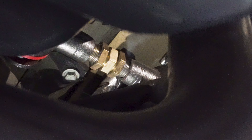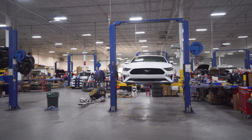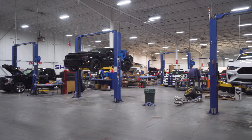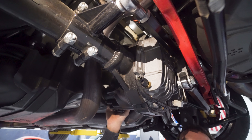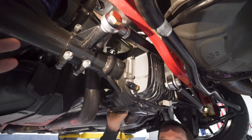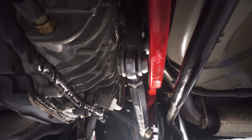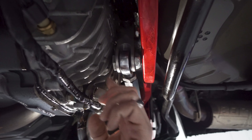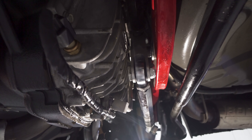If those don't hold it, this thing — you spin it one way it contracts, makes it shorter; you spin it the other way it extends, makes it longer. And obviously it's gotten to the point where now you're bumping on the cradle for the watts link. If it didn't start rubbing on there it would have kept going — I'm not sure how many more threads are in the ends, but if it goes back far enough it will just fall apart and that center link will fall out. We should have another quarter inch of clearance between the bracket and this nut.